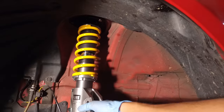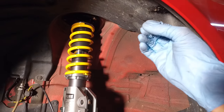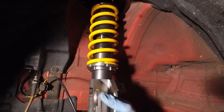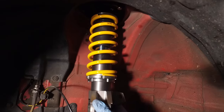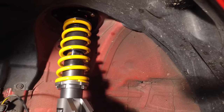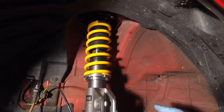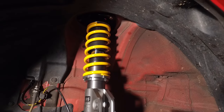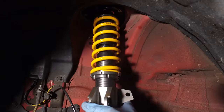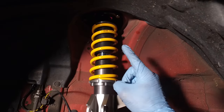On lower-end camber plates or low-end coilovers that include the top hats or shock mounts, they don't have a good bearing system in the camber plate, or they don't have one at all. So when the coilover body turns left or right, and it doesn't rotate too much, but it does rotate, you get a twang from the spring, because the spring on the coil is binding up as you rotate, and then it'll catch and release. It's not really bad for the coilover, but it sounds bad. A lot of people have issues with that when they're in a parking lot or whatever. The Velox camber plates do not have that issue and will not have that issue. As you can see here, it rotates really well with the spherical bearing it's got on the top of the camber plate.